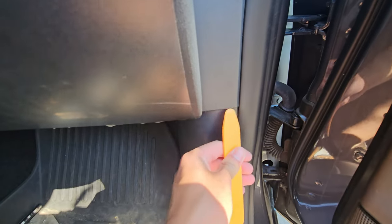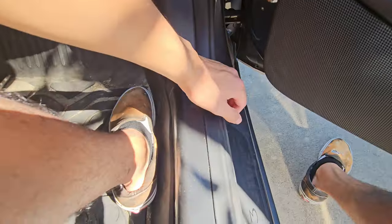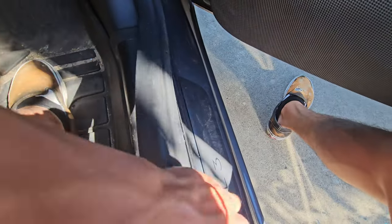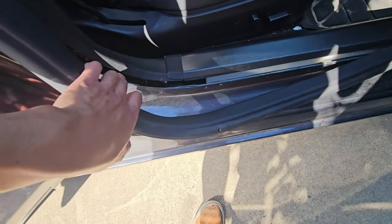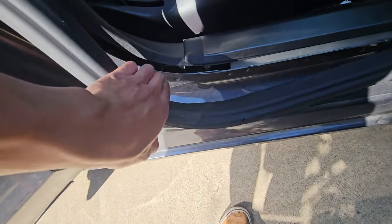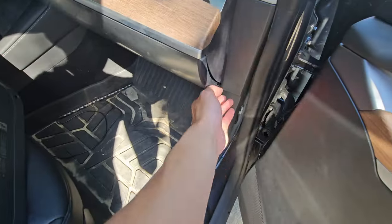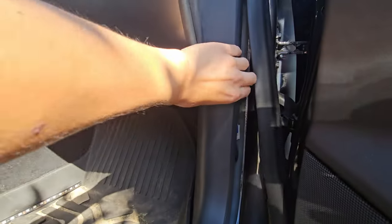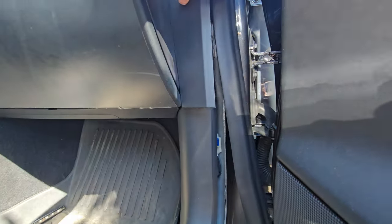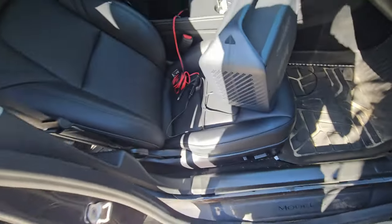That will allow us to move this plastic up and down, and then we're going to go inside and remove some of the flooring and paneling so we can see where our wire is coming. This piece needs to come off — you can use a pry tool. My recommended pry tool of choice is the ones that came with the sexy buttons, which you can find in the description. Also, remember to remove the weather stripping first — just pull up gently, it sits in a groove.